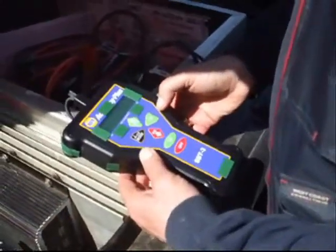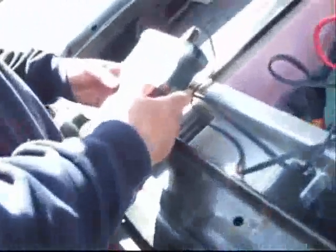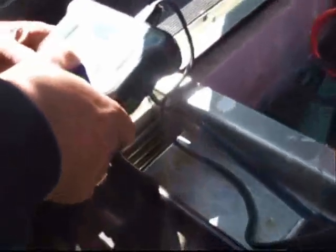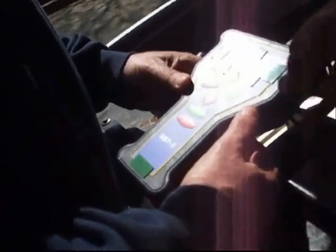Now it says... it wants you to wiggle. This battery — 11.94. That's a different reading from the other one. Let's try the other one instead. Wait — now it's okay, now it read 11.65. I think you had a loose connection there. Now it's the same. It depends where you have it clipped — if you have it clipped on a washer, you'll get an incorrect reading. That's why you wanted to wiggle the clamps. Now you've wiggled it and it's got a good connection.